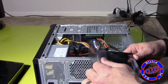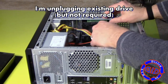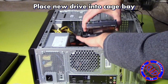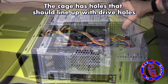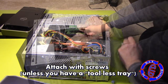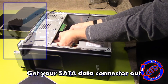The first thing we're going to do is go ahead and unbag the drive and see how we can best configure this to fit in the drive bay inside the computer. I'm going to go ahead and unplug my existing drive so that we've got a clear, clean line of sight to where I'm going to slide this new drive right into the cage. If you're buying a new drive, don't forget you're going to need screws to hold it in place if it doesn't come with clips, and you're also going to need the drive connecting cable. You can repurpose all of those materials from an old computer, or just buy them online because they're not that expensive.